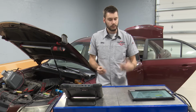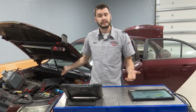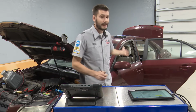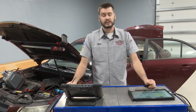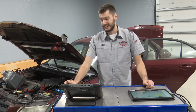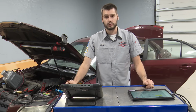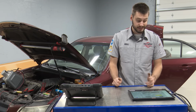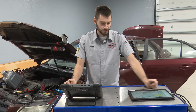Get what I'm saying here, guys? Get why my frustration's already building on this vehicle? Because I diagnosed this thing, I looked at this thing, I figured it out without ever having it on the hoist, guys. This vehicle has not been in the air yet, okay? Look in your service information, especially when we're dealing with fuel pumps, Asian cars especially, guys. A lot of times there's a way to access that through the trunk or through the back seat, okay? So already we've spent a significant amount of labor to throw a fuel tank pressure sensor at it.